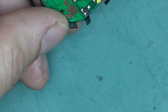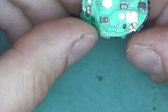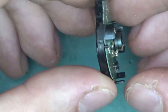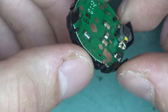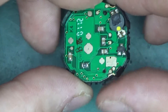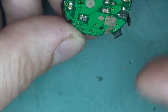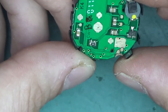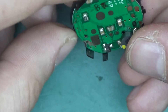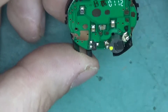This is an oscillator circuit to produce the high voltage that drives the electroluminescent backlight. It doesn't need to be extremely high voltage — just a few tens of volts, around 50–60V. When you engage the backlight, if you put the watch to your ear you can actually hear the squeaking noise of the oscillations at a couple of kilohertz.